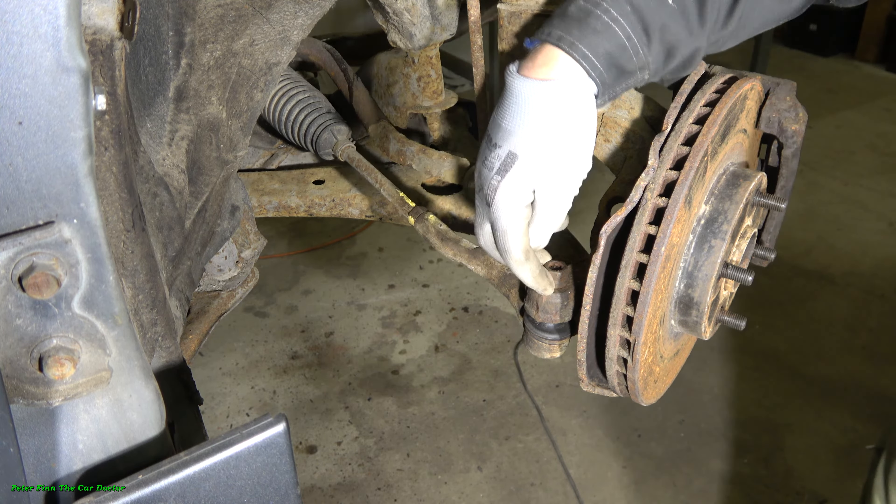Next is the rear engine mounting removal. There are really two bolts in that upper area, and in the lower area there are also two bolts. These lower bolts are easy to open. There are two 14 millimeter bolts here — that's the first one and then the second. In the lower area there are also bolts in the inner holes. Now I open and remove all four bolts.